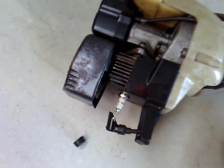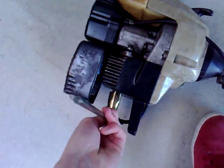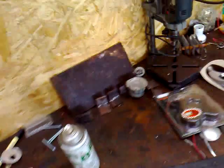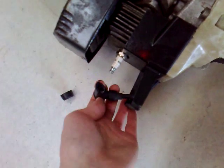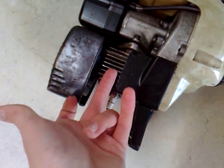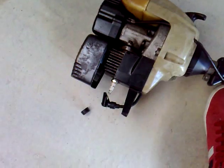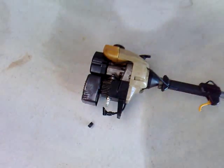To take off the spark plug, there are all different sizes so there's no one specific size. Get your spark plug tool — this one here is for bigger four-stroke spark plugs — or you can just use a spanner. Once it's out, plug it back into the HT lead and sit it against the head, because it needs to ground to the engine to be able to spark. Then give it a crank to test.